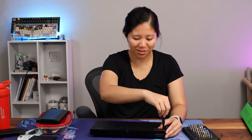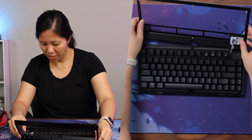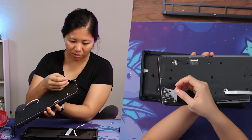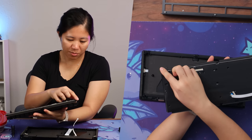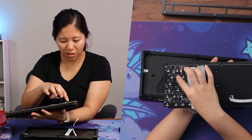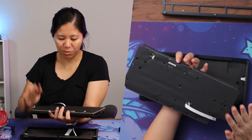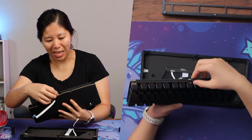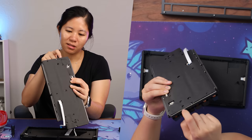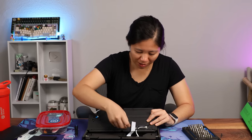Note that doing anything to the internals does void the warranty. With six screws, the top case comes right off — there's a ribbon cable to disconnect. Here is what they mean by their enhanced tape mod: it's very thick, much thicker than any tape I've used. On the PCB, there are holes to install PCB-mounted stabilizers — you just take off the plate-mounted ones and screw in there, without even removing the tape. The gaskets are massive, there's foam on the sides of the case, and a nice layer of foam between the PCB and the plate. Very clean internals, very easy to take apart and reassemble — just six screws on and six screws off.